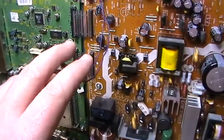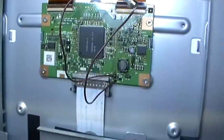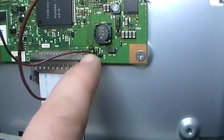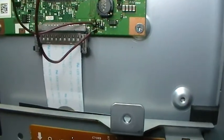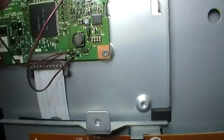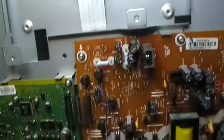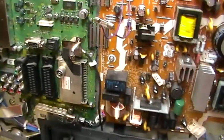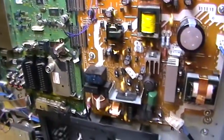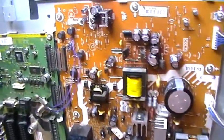After repairing that, still not getting any progress. Then I found that on the T-Con, the fuse which sits just here — which is a 2 amp — there's a normal fuse, because I haven't got any in. I'm going to get some in. So if you get no sound, no picture, but the backlight's on, then there you go — there's the problem.